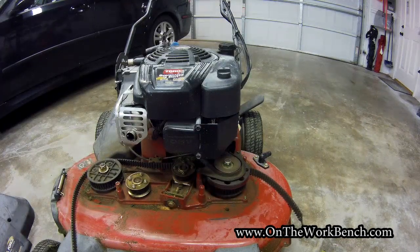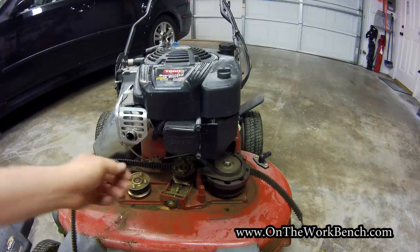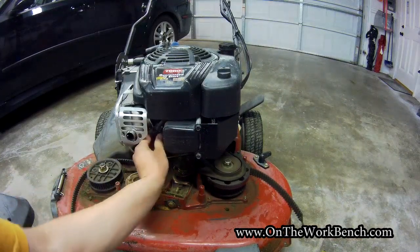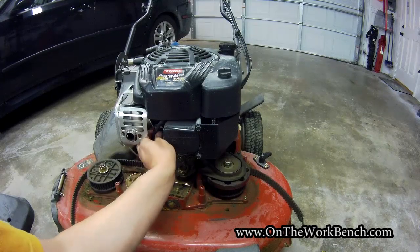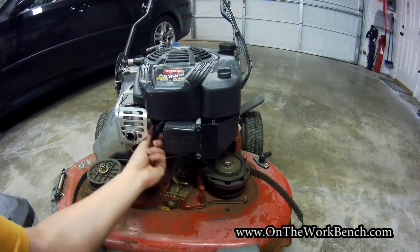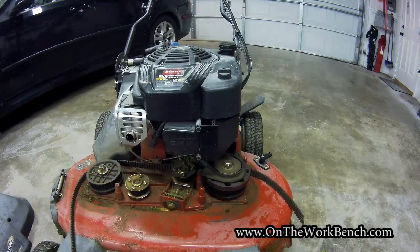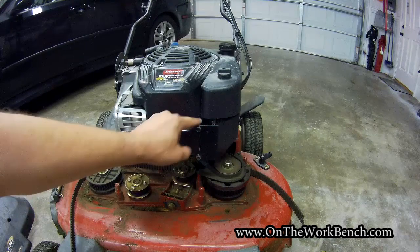You may want to clean it up and get any grass out. The other important thing to do — just to make sure when you're working around the blades and the engine — is to go ahead and remove your spark plug wire. Now the engine can't run, so there's no risk of accidentally getting the mower started.